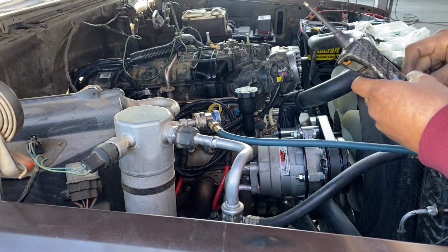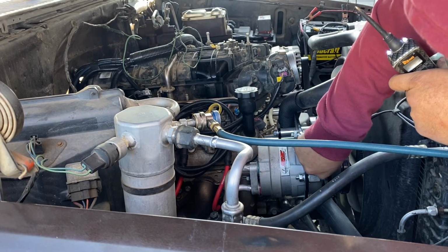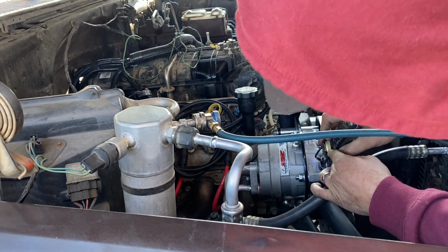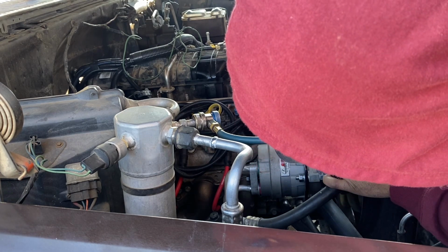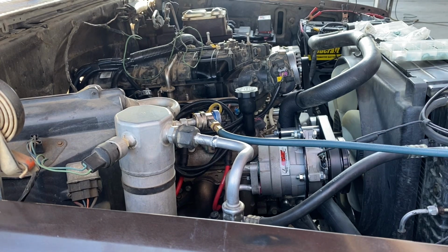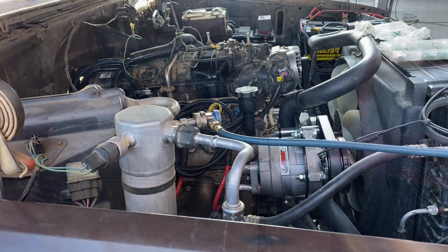All right, I got my power probe. It has a ground here. So we'll go ahead and ground that. Shoot 12 volts. That was our clutch engagement there. I'm gonna go ahead and start it. Put some Freon in there, and then I'll just command the clutch on real quick. Just see if our low side's gonna get cold.